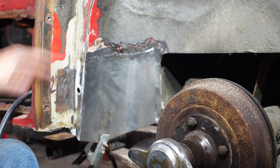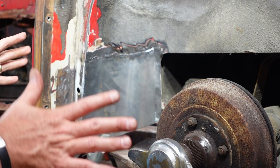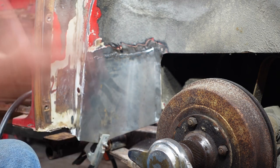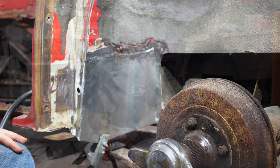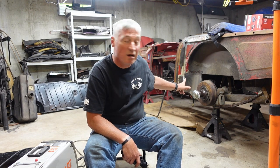That's not too bad. I can get to this bead from the other side and I think I'm going to do that, but not now. That's the first major patch — this one up here is a little smaller. Nice to get some structure back in. There might be one or two more patches I want to get in before I really try to get the floor in. There will be some spots where I won't be able to weld the floor because the frame is there, but I want to get the sides and corners done to give it good structural stability for eventually taking the body off. Hopefully we'll get the floor in and keep moving towards that goal. Thanks again, have a good rest of your day. Cheers.